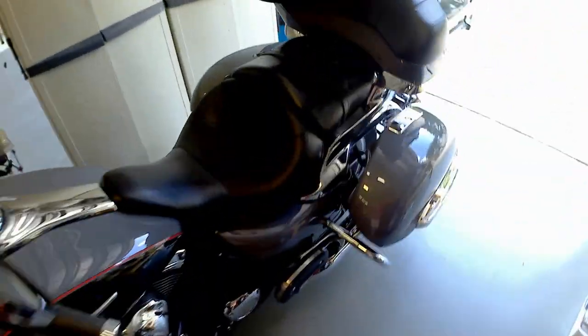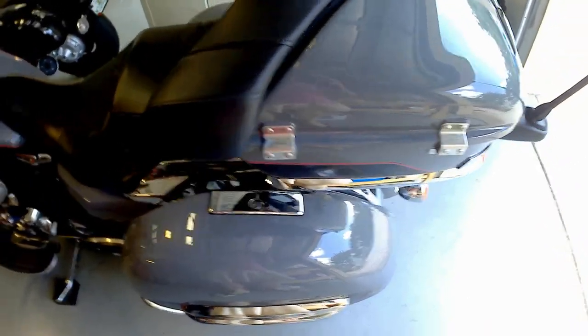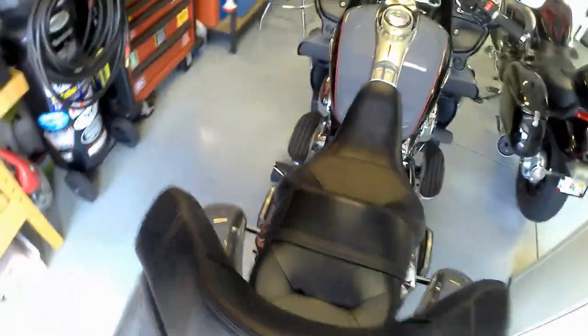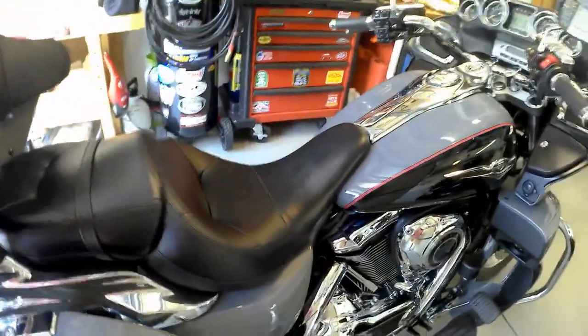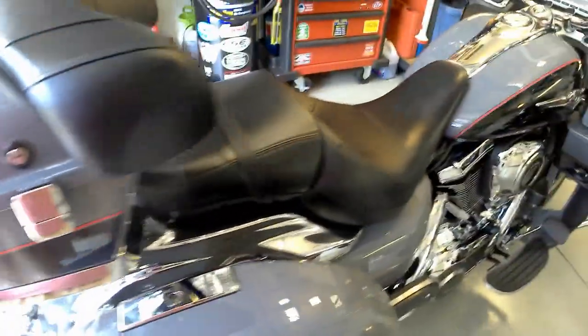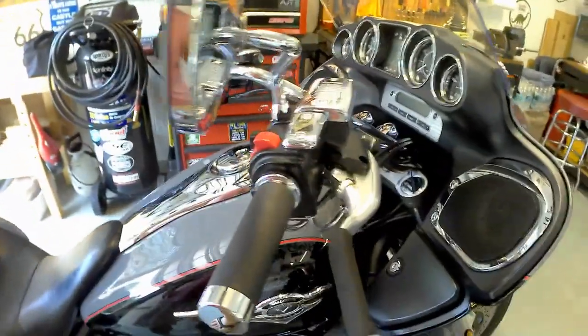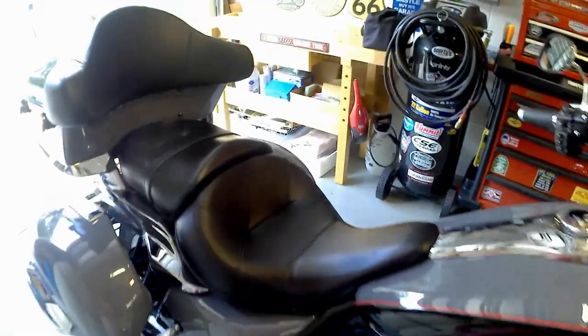Everything's back together and the pipes are awesome. I just took it for a little drive — there's a bit of popping, so I'm definitely going to get it retuned for another $300-400. After that I'm pretty much done with upgrades: K&N air filter, better-flow slip-ons, and a tune — it'll be awesome. Don't be alarmed if you put new pipes on and see a little smoke or smell something — that's just shipping oil burning off the insides. It'll burn off after a while and be replaced by a little carbon. Can't wait to take this for a real drive. Like, subscribe, and hit that bell notification for future content.